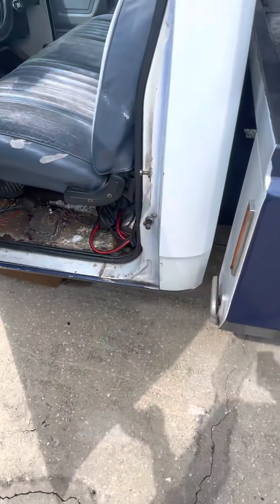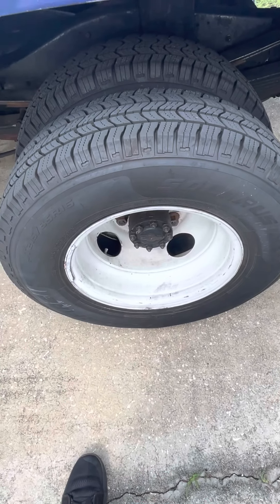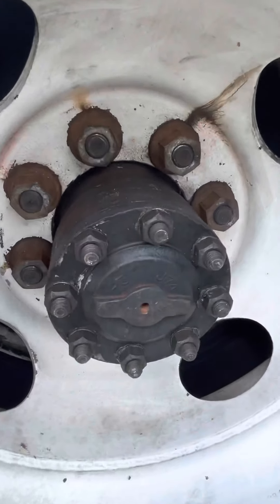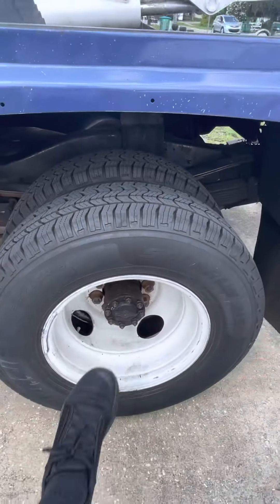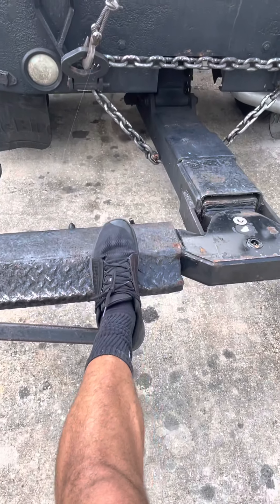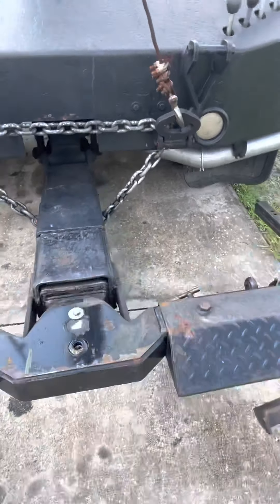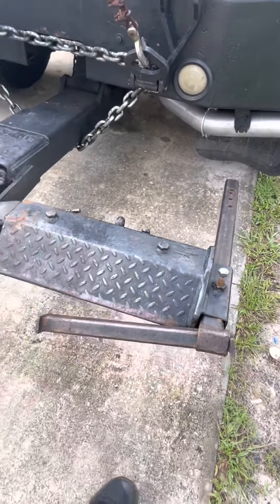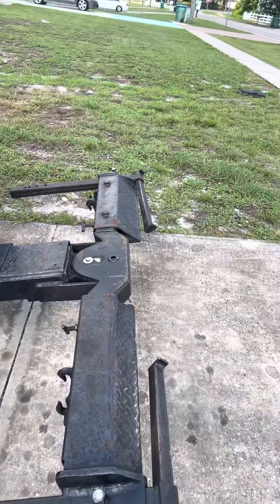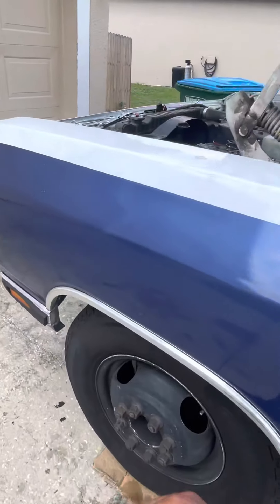I know the brakes are going to work much better. This truck is driven every day. Next, I'm going to do a rear conversion on this axle — it's a Dana 70 U2 with 3.54s, the heavy-duty version. I have the studs, so it's 35-spline to the actual shaft. I'm going to change this system to an auto-grip system, electric over hydraulic, so I can get more power in that boom — basically like a repo truck that hooks up everything automatically, which makes it easier to pick up junk.